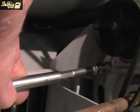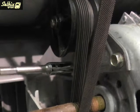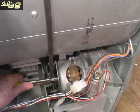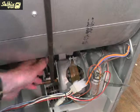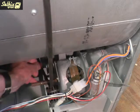With the impeller out of the way, you can get access to the bolt at the rear of the pulley assembly. Use an 8mm socket and undo it. Then loosen the front bolt, but don't remove that one. The pulley will pivot down from the back, but it will be tight, so may need a bit of assistance. Once it's dropped down, you can ease the belt over the wheel and off.